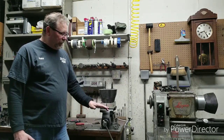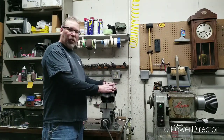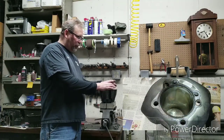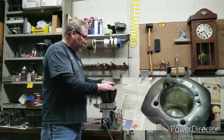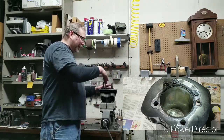What I wanted to talk about is torque plates, because what happens is these bolts that come through this cylinder distort it. I tried posting a picture in one of the other videos of one I've pulled off — just a stock factory job — and they distort it. It's kind of like they go around like a stop sign.